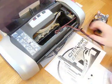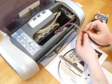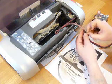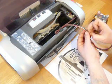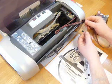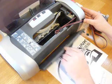just like so. So we're going to remove the backing tape from this one, and then we're going to mount this clip. So I mean, you can still see some air in some of the lines here, but basically to cut down on the video time, I haven't primed them all. So if you do a couple of head cleans, nine times out of ten they will disappear anyway. So we're going to mount this just over here so that we can still open the paper tray,